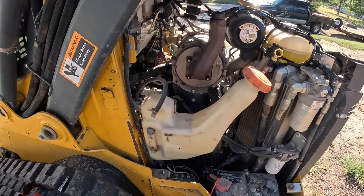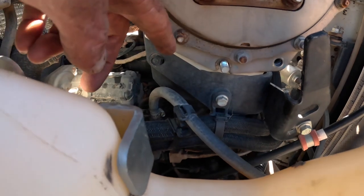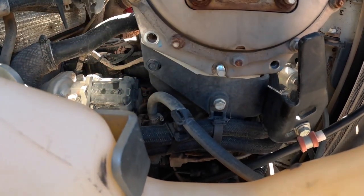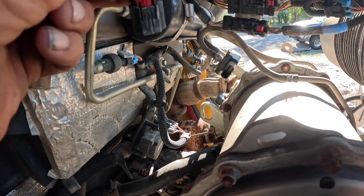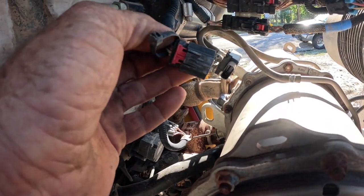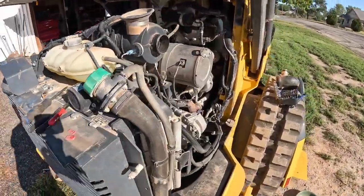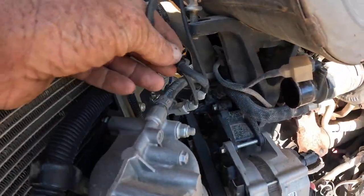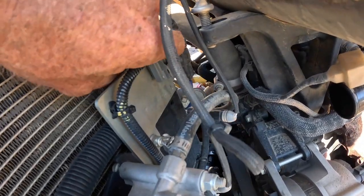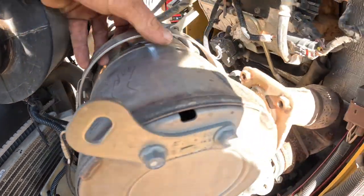So I've never done a project like this before. After looking around, I've found that there's three bolts in here that must be removed. You must unplug this sensor — pull the little red tab back and then they come out. On the other side there's two more sensors, plugged in under here, color-coded. Bolts must be removed from this strap.